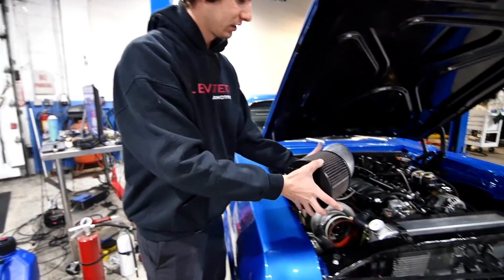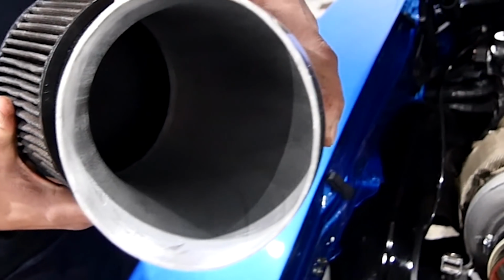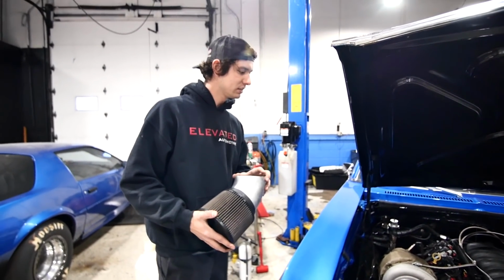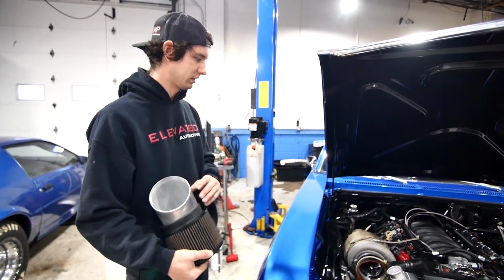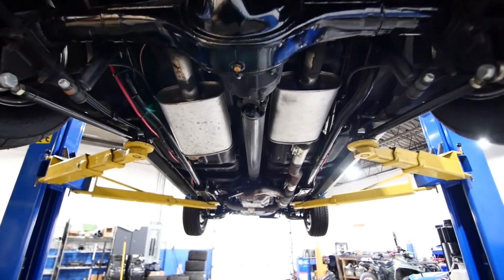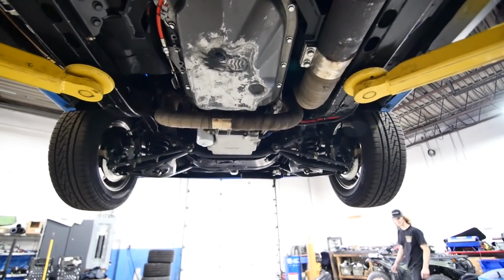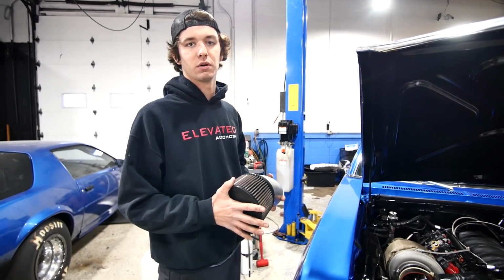They have this in here like that, but if you take it off and look, it goes all the way to the end, which doesn't let anything in. So we pulled that off and that helped more, but it still is not right. We're thinking it is due to the exhaust. It has full exhaust, like a 4-inch downpipe that splits to 2.25 or 2.5-inch big suitcase mufflers. I pulled one of the sides off real quick. We'll get it on the dyno later today to see if that was the culprit. If he wants to make more, he's gonna have to do something with the exhaust. But for now, it runs.